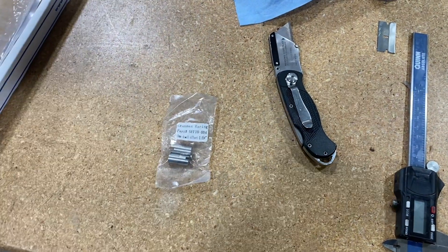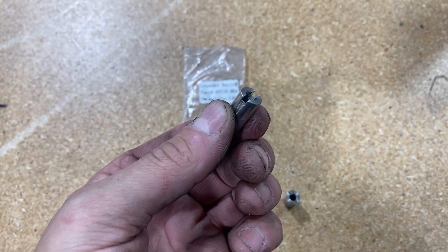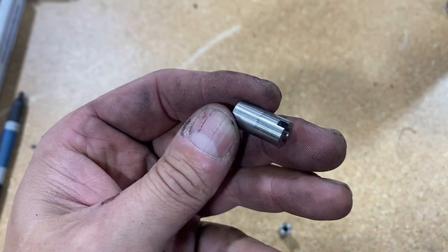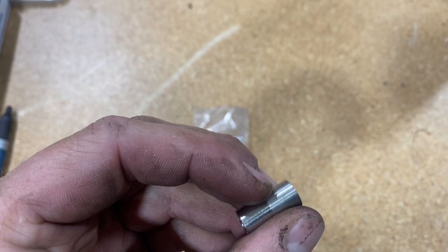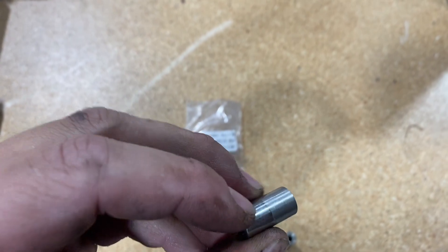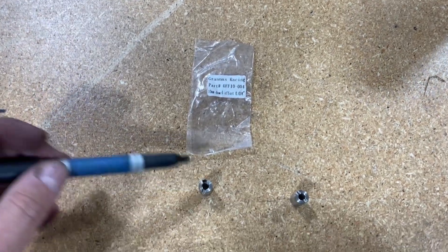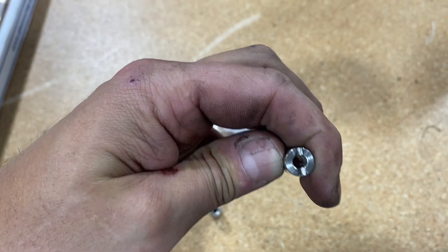These are my new offset dowels and you can see they're a lot heavier duty than other manufacturers. They have a flathead slot so you can put them in the block and spin them with a flathead screwdriver to get them indexed in the direction you want. On these dowels there's a high side and a low side. It's only 4 thou — like two sheets of paper thickness — so you can't really see it. I recommend using your fingernail to find the high side, which will be in line with one of the screwdriver slots. Then take a sharpie and mark your high side on both dowels so you can see it in the car and know which way to point them to move the bell in the right direction.